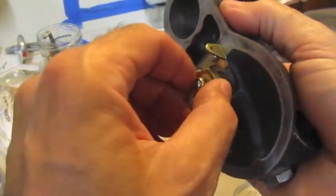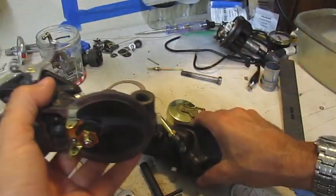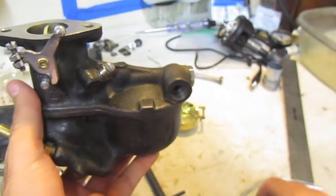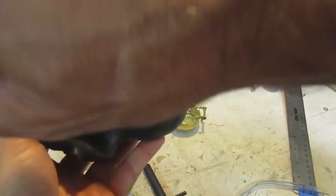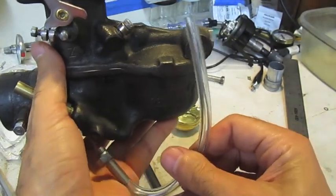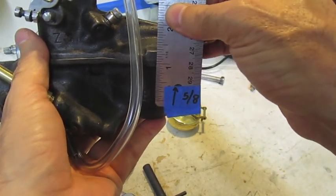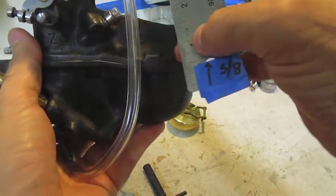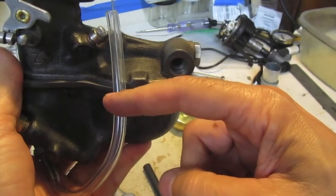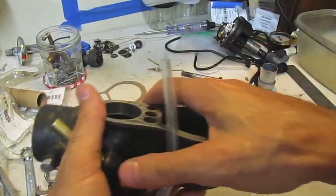The process is a little tedious: put a shim on, screw the float valve back in all the way, assemble the float in here, put it back together, and fill up some gas. If it's attached to your Model A, just turn the gas valve on from the firewall — the fuel will fill up and stop. Then attach the indicator at the bottom and measure the fuel level again from the bottom casting. Mark five-eighths on a ruler and keep adjusting until you get it right.